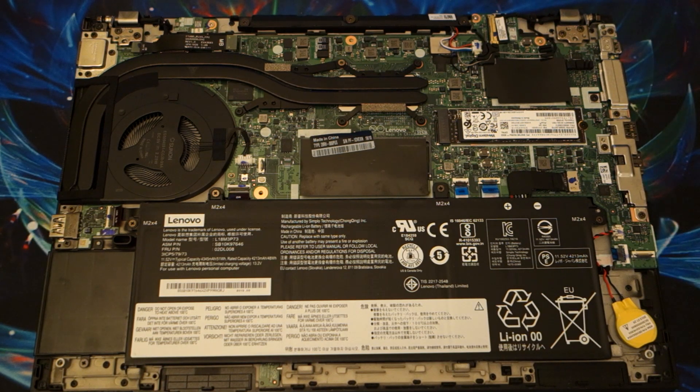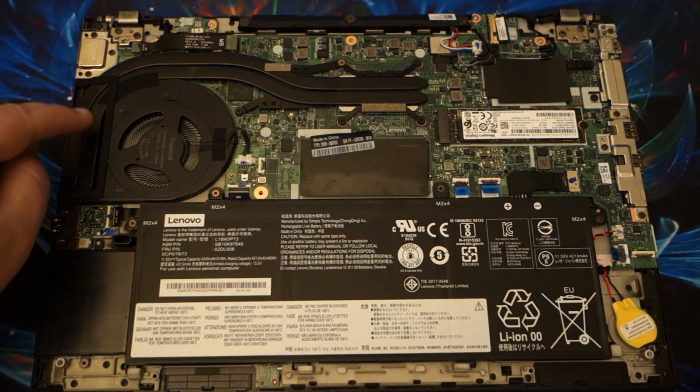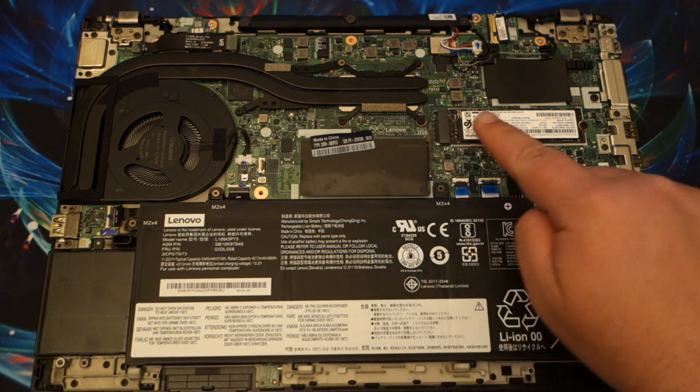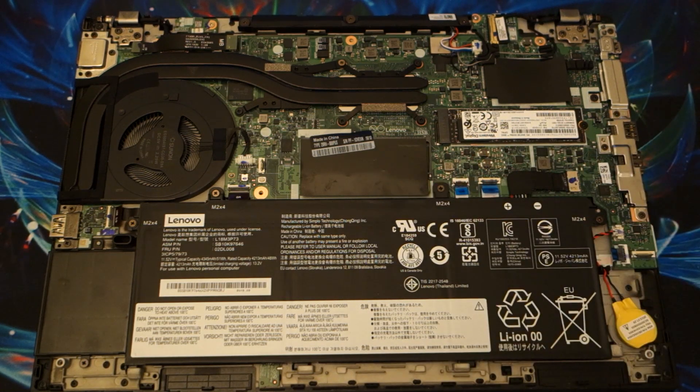With these new systems there's very little that's upgradeable, very little that you can swap out. It has a nice big fan with a nice big heat sink and heat pipes for the video and graphics cards. But other than that it's pretty basic — there's not a whole lot you can do with it once you get it. You can swap out your storage and upgrade your memory a little bit. This already has 32 gigs. Can you get a 32 gig DIMM currently for a reasonable price in DDR4? That would be the only real upgrade — going from 16 to 32 on that slot, which would give you 48 gigs of RAM.